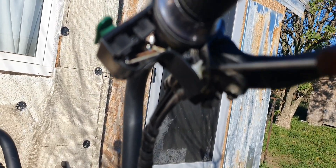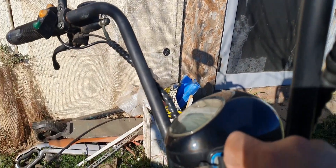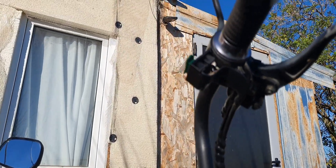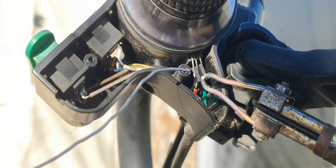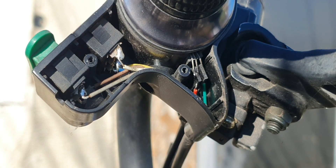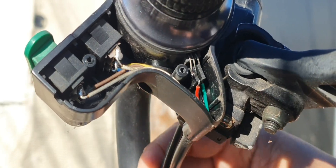I can already see that the wires aren't attached — the red wire isn't attached to the transistor. I'll turn off the scooter and I shall try to resolder that wire. Fresh solder. The wires were kind of tight in here, so that's what caused the whole thing.